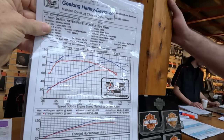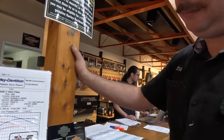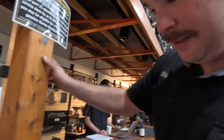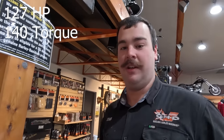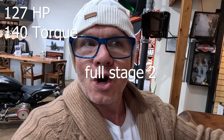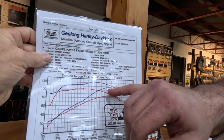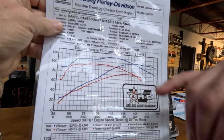The 117s come out from factory so good, it's hard to get heaps out of them. So that's about 127 horsepower in Dynojet and about 140 foot-pounds of torque — which is going to feel pretty quick on a light bike. It's got a really nice broad torque curve, pulling hard right off the bottom all the way till you're really starting to feel the drop at 4,700 RPM. You've got heaps of power everywhere.